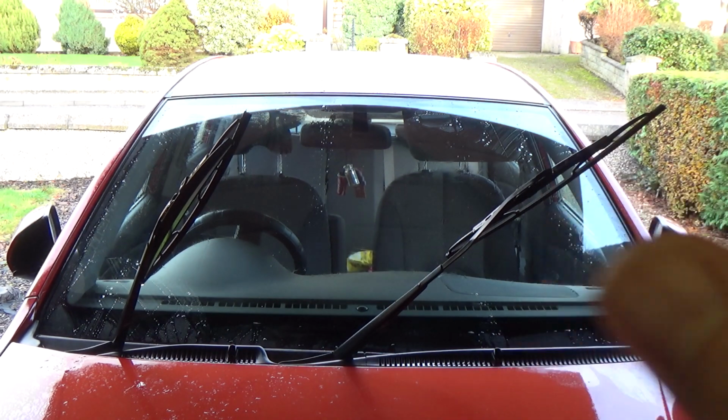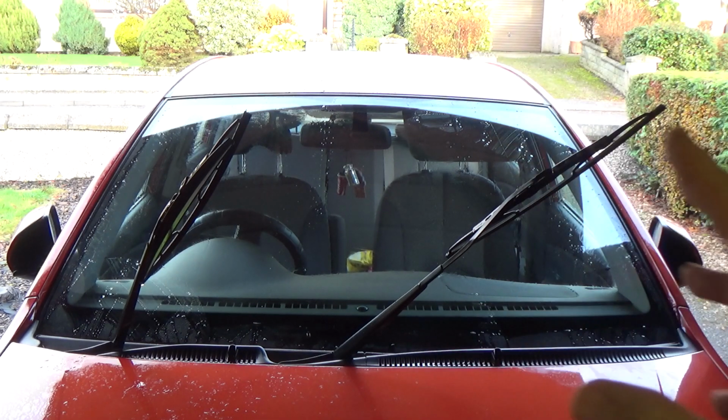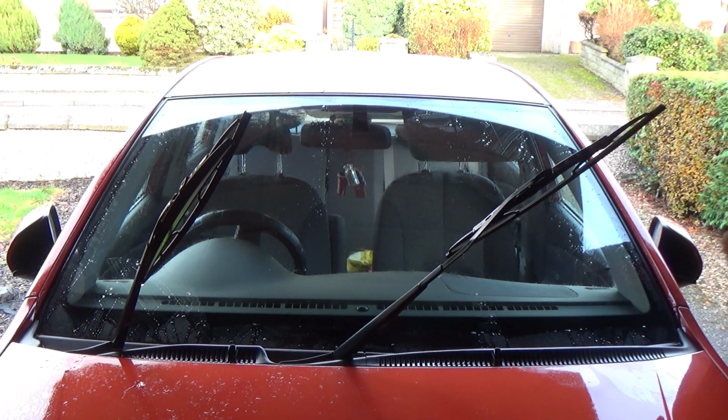Alright, so that's the windscreen now scraped. You don't need to worry too much about going right to the edges because that's not where the wipers are going to go. We want to make sure that the area the wipers cover, where you get your primary visibility from, is sealed, but I do want to make sure we're putting down a brand new sealant surface anyway.